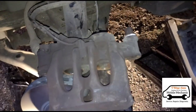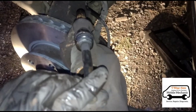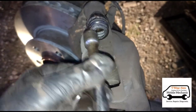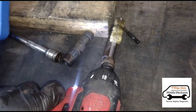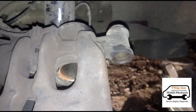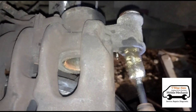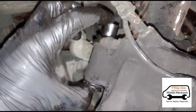The sliders here on the caliper are completely solid — they're not moving, both of them. So I'm going to have to hammer them out with a chisel punch and a hammer. I'll just use a ratchet extension — 3/8 size, it fits perfectly — and just hammer that out. Now we've got it out. We're going to grease these up and clean inside. I'm just using a little wire brush on a driver here to go around them and clean them up. Now we've got those back in and they're sliding up and down nicely.